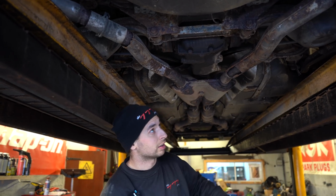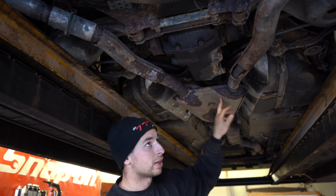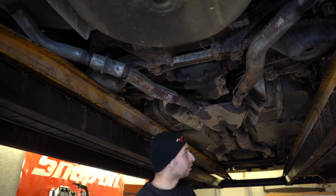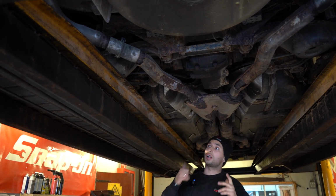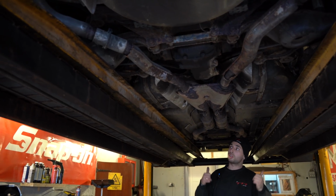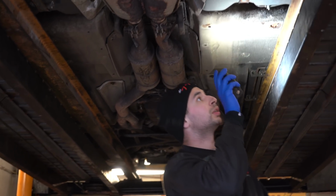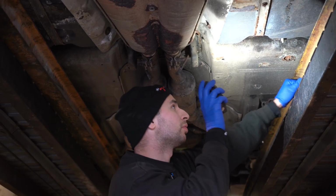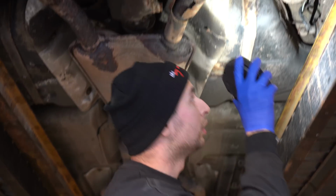All that is rusting out. I mean, it's not a MOT failure, might be just advisory or so. What else? Yeah, just need to have a look at the brake pipes and the fuel pipes, and then we're going to check the suspension and tires. What I don't like so far is probably the fuel pipe. That seems to be bodged already by the previous owner.